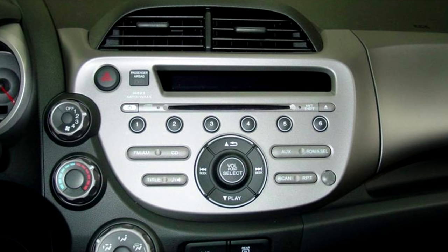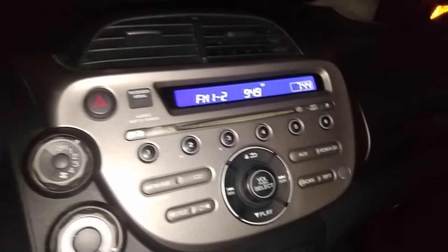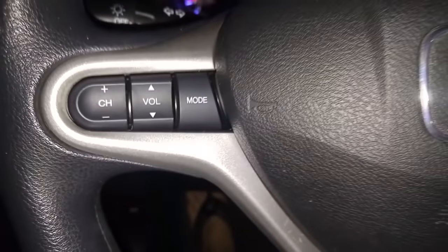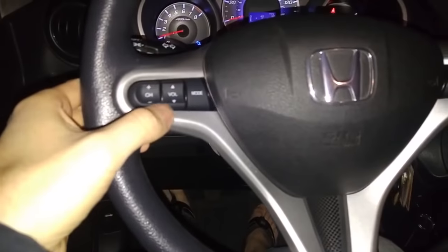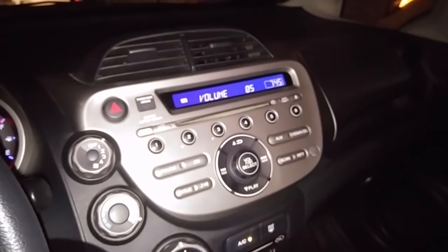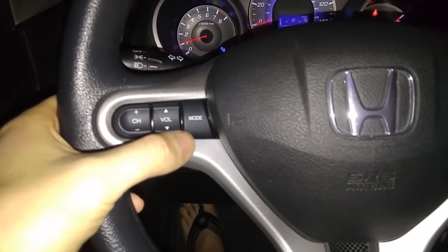Replace all the covers and reconnect your battery — and pray. The airbag light went off — good. Radio still works. Let me check the illumination — yeah, it works; if I could turn the flash off you'd see the buttons are glowing. And when I press volume, does it go up? Yes. If one function works, they'll all work because they all use that one wire.